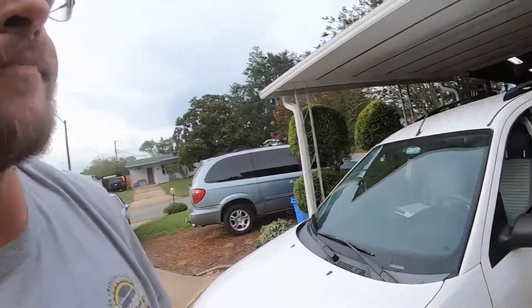So what we're doing is replacing rear shocks, because on some road areas where you've got potholes or severe bumps, the rear end just gets real unsettled and it seems like it dances back and forth. Could be a couple different things. I just looked underneath before doing this video, and it could be lower control arm bushings in the back possibly. But we're going to try the shocks first and see how that goes.